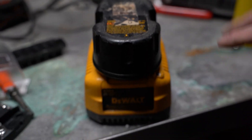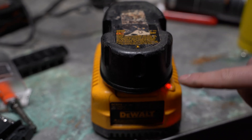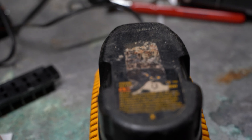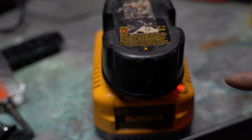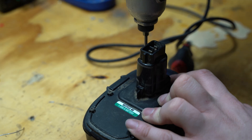Now we'll put all the screws back in. Just make sure you don't over-torque these — go nice and slow. Once you hear that noise, just let off. These are working — they should click inside the drill. Let's take it downstairs, put it on the charger, and see if it takes a charge. Here's the final test — put that in the charger. There you go, it's taking a charge. If this blinks really fast it usually means a thermistor problem, so if you didn't do that thermistor part right, this will start blinking — open it back up and check again. I've done these so many times now, I'm not surprised it's working. Thank you for watching, and if you enjoyed this content please like, comment, or subscribe.